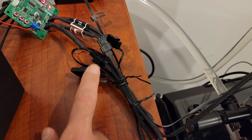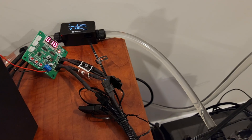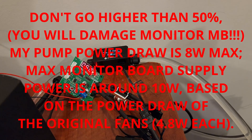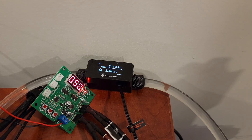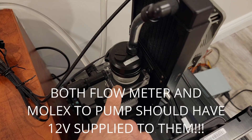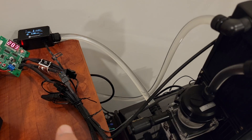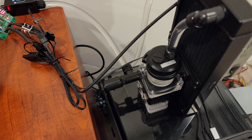On the top one, I'm using 50% PWM. The 50% is for the PWM on the pump and the fan, and then the flow meter slash temperature of the water — this one needs 12 volts. This one needs 12 volts, and the molex to the pump also needs 12 volts. So the top one is at 50% for the speed of the pump and the fan, using a splitter, then another splitter, and another splitter for the 12 volts to this and the 12 volts to the pump.